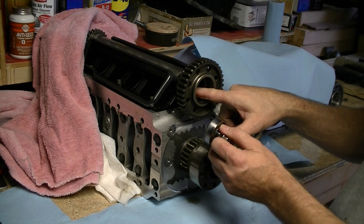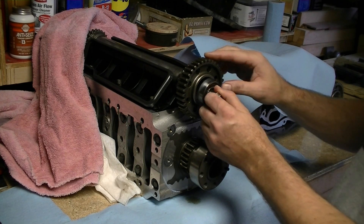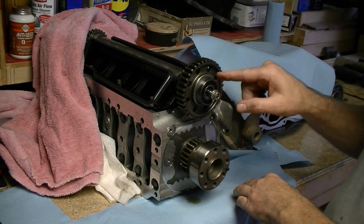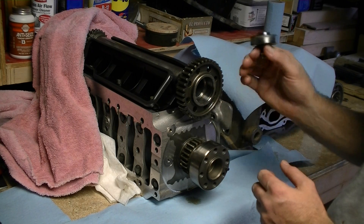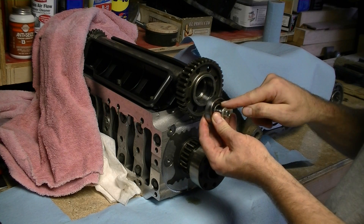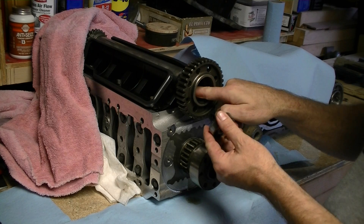This tube was full of oil when I took this bearing out. There's probably about half a cup of oil in here. Sitting on the bench, this bearing didn't leak any oil at all — it appeared dry. Taking it out, I had a rush of oil come out. So I know that oil has gone either around this bearing and into the tube, or through this bearing seal, through the back seal, washing out the grease and into this tube.